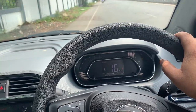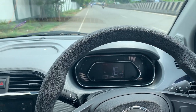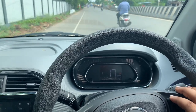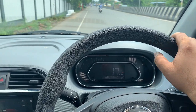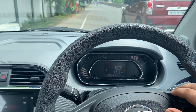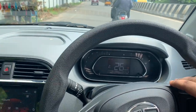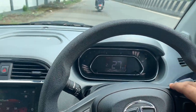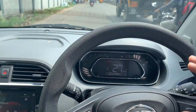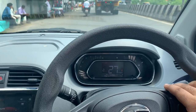When the speed reaches around 15 kilometers per hour, the doors automatically lock and it checks that I'm wearing a seat belt. I'm now going at around 70 kilometers per hour. When I bring the speed down to 20 kilometers per hour, it automatically shifts to second gear, as you can see on the display. The gear shifting is aligned to speed.